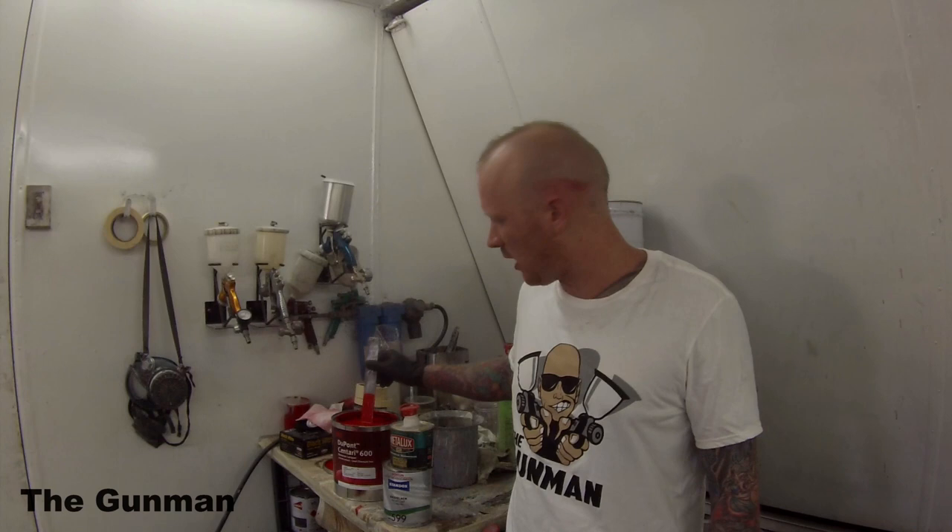The way we go about doing this is putting our base coat color down first. This is a DuPont Centauri 6000 range base coat, and we've got four liters in. These reds don't cover very well, so we decided to get the full four liters. We're painting the entire car except for the inside of the door jams.